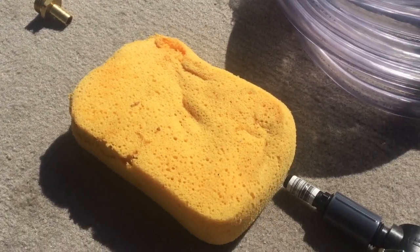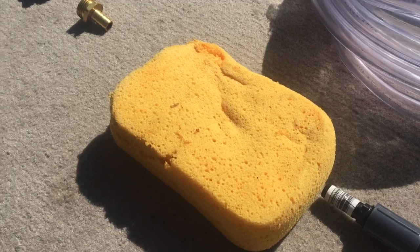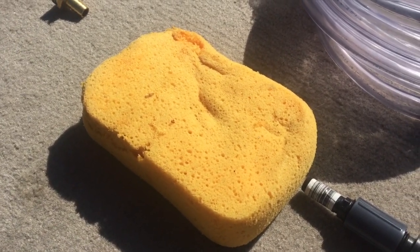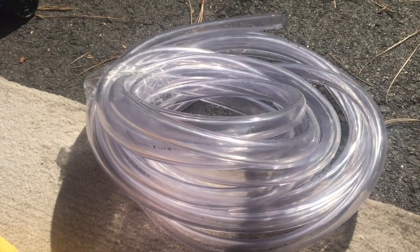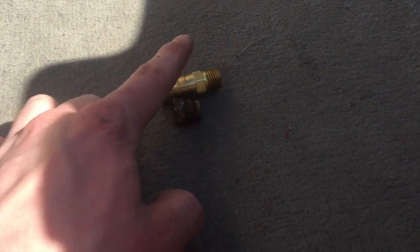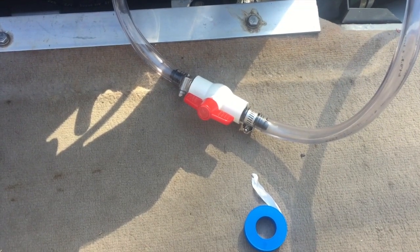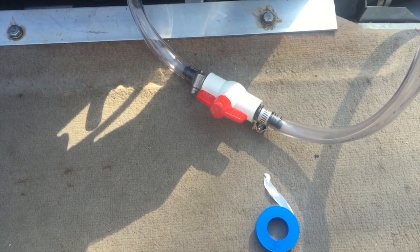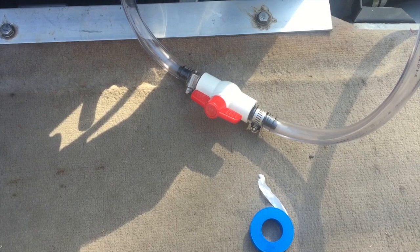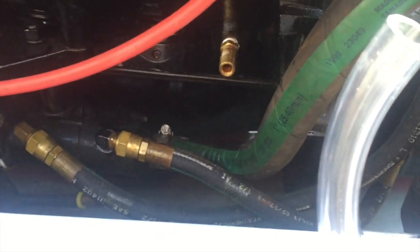From the hose I need to go all the way up to my dashboard and then I can plug in the switch and connect the power, and I'll be good to go. The hose I'm using is a half inch hose. I just took out my drain plug and I'm switching it with a nice clean brass fitting, which will connect from my heater core hot water to the hose. I made sure to use plumber's tape on those connectors and a half inch tightener on the hose. Now I'm going to connect that hose on the engine block for the hot water.